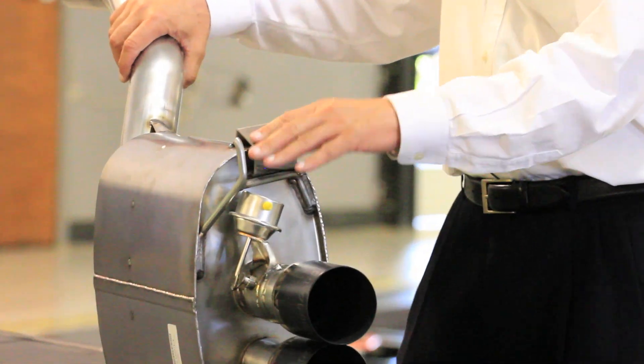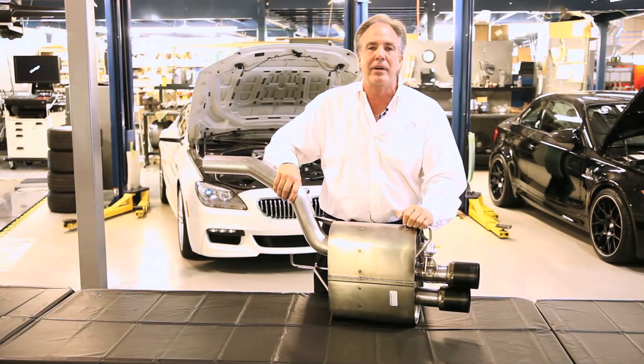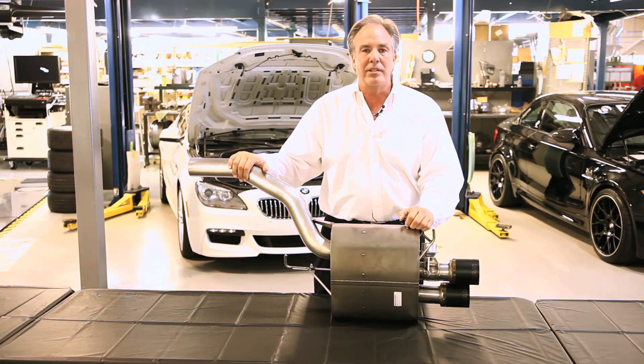In addition, we put this mount on. The original exhaust has a vibration dampener, and the point behind it is that it's matched to the frequency that the exhaust vibrates at, canceling that vibration so the exhaust won't crack.